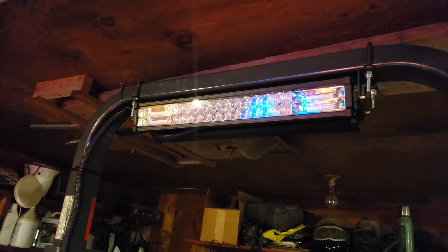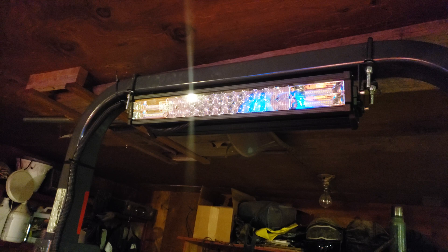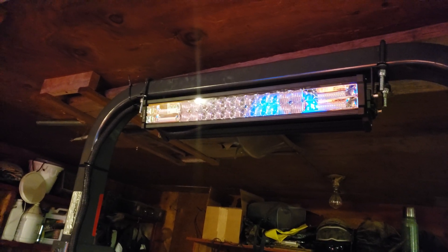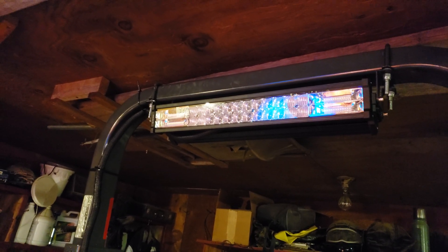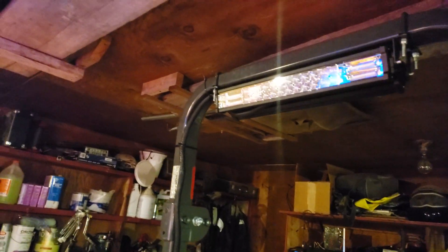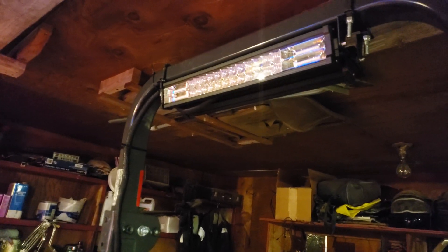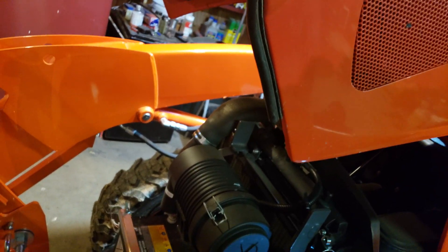That is 216 total watts. When you've got two of them up there, front and back, you're way over 400 watts. So I wanted to run a separate switch for both from a separate circuit, which I did. It's an 18 amp draw if you divide 216 by 12.